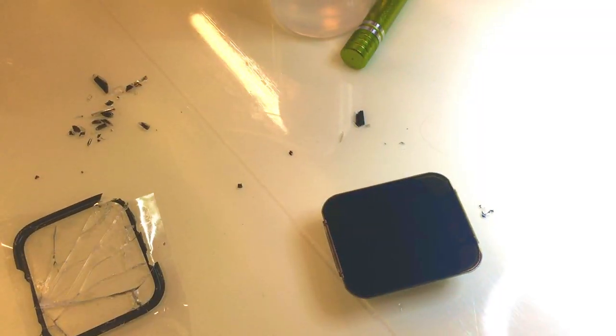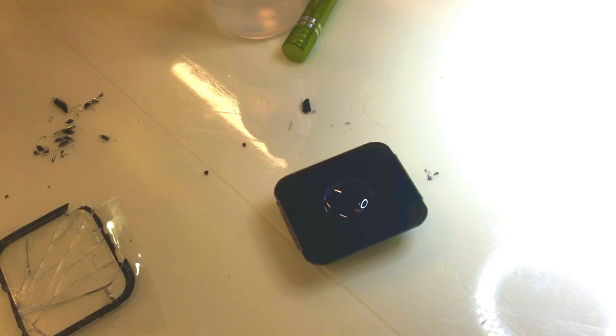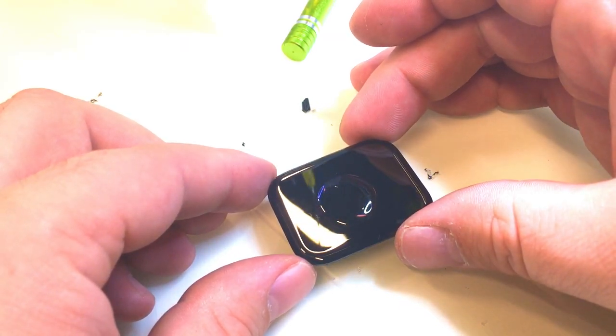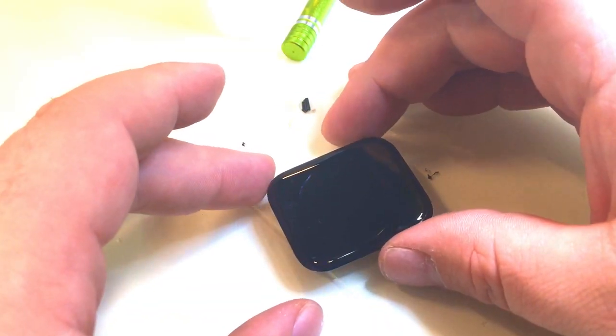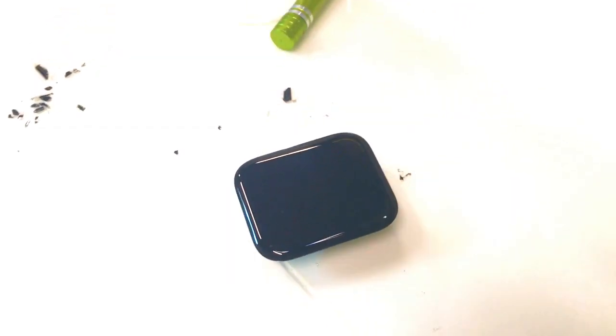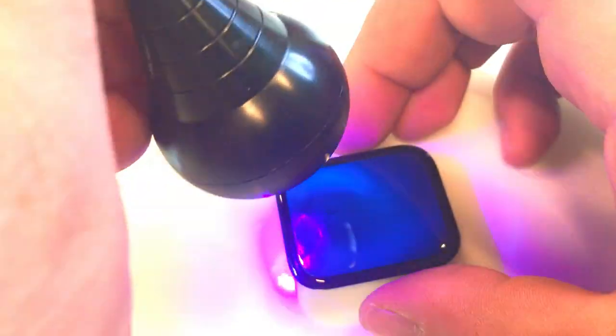The first thing I'm going to do is prop up my screen on a little stand here — it's made of wax — and it'll allow me to clean without moving or touching the top of the display. Once I have it clean, free of dust, fingerprints, smudges, smears, and streaks, I'm going to apply a little bit of LOCA — a liquid optical clear adhesive. Installing the glass at a slight angle and carefully lowering down the other side, I'm able to get the LOCA to stick to the glass without leaving any bubbles. If you use too little it won't spread evenly; if you use too much it can spill around to the back and get into the connectors and damage the display. Once I've centered the display with the glass under my microscope and ensured it's perfectly aligned, I'm going to use a UV light to cure the LOCA, and then move it into a better UV light to let it bake for enough time to fully cure.